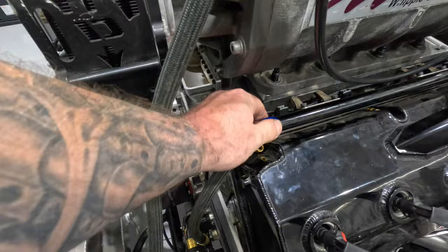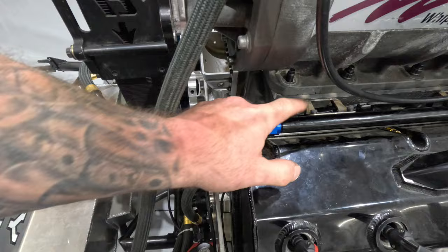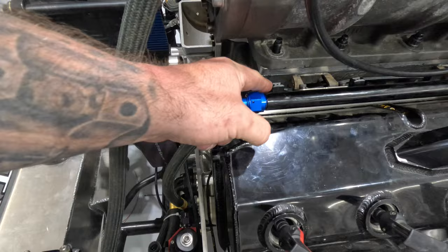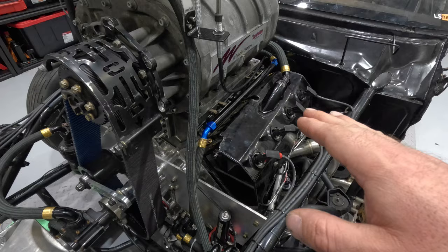The reason you have a rising rate regulator is because you have 90 psi in the rail and hopefully zero boost pressure below the injector — giving you 90 pounds of fuel pressure delta on the injector. If we run 50 pounds of boost, we should have 140 psi of fuel pressure up top, which keeps that injector still a 700 pound-per-hour injector, because it's maintaining a 90 psi delta from top to bottom. We have to overcome the pressure in the lower intake manifold with the regulator so the injector stays its rated size.